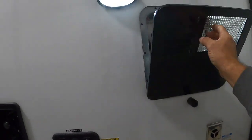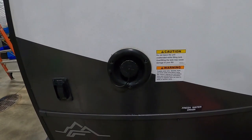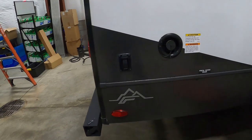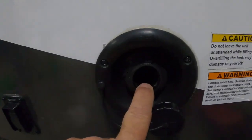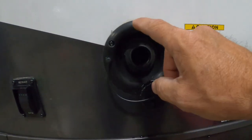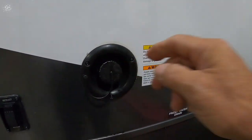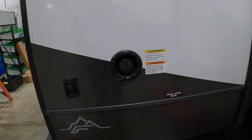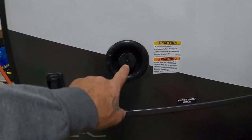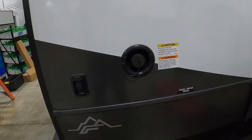If you're going camping and not using city water, you'll go dry camping. In that case, fill up your fresh water tank. At the campside rear corner, no water pressure regulator is needed — you can simply gravity fill it with a hose. Two ways to tell it's full: there's an overflow valve right there, or inside where you check your black and gray tank levels there's also a fresh water button — keep an eye on that when filling. Once it's full, remove the hose and turn on your water pump indoors to utilize that water. Don't turn on your water pump when hooked up to city water, as that is already pressurized.